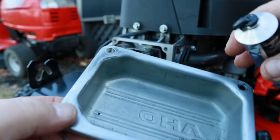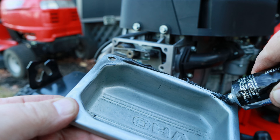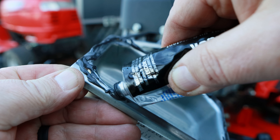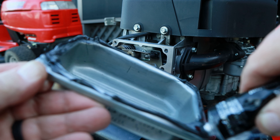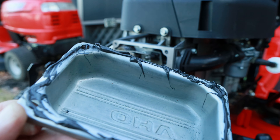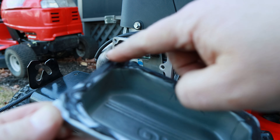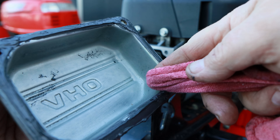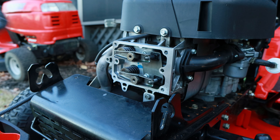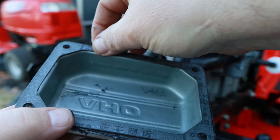Now we can go ahead and put our valve cover back on. You can use Permatex or a gasket — I like to take a little bit of Permatex and do both. I'll put just a thin coat of Permatex just to hold the valve cover gasket, rocker cover gasket, whatever you want to call it. That way, if you ever have to take this apart again to check or adjust your valves, your gasket will come off on the valve cover and a lot of times you can get away with reusing that gasket. Just put Permatex on one side — don't stick it to the head side. Smear that around there. Take a rag and wipe around the inside — you don't want any of this on the inside of the valve cover. Then set your valve cover gasket back on. I'm not putting any Permatex on the engine side, just on the valve cover side.